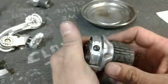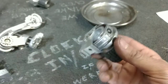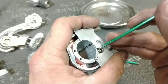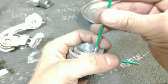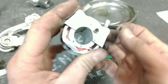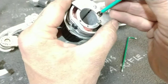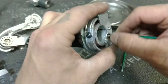Now the detents are achieved exactly how I would do it if I was going to CNC machine some stuff in my garage or my small company. Because all you need to do is use a ball bearing detent. You see this a lot on small run productions of things that I play with, knives, shifters. Sometimes you see this in gun parts.